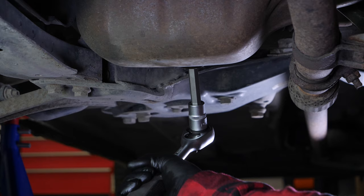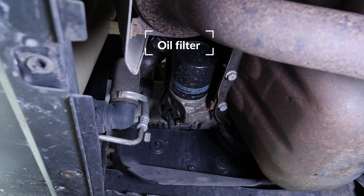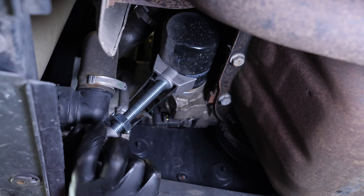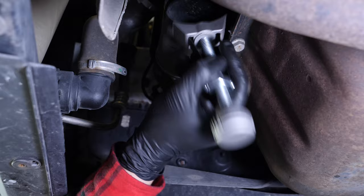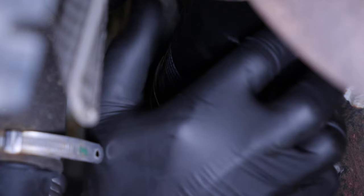When you change the oil in your car, you must also replace the oil filter. You access the oil filter from below. To prevent the oil contained in the filter from spilling out, place the liquid collector underneath. Loosen the oil filter. If you are unable to do this by hand, you can release it with an oil filter wrench. If the filter remains stuck, watch our video on unscrewing a blocked oil filter. Remove the oil filter, and when released, turn it upwards to avoid spilling any oil.